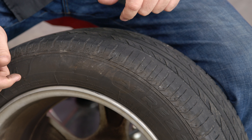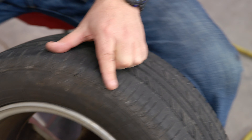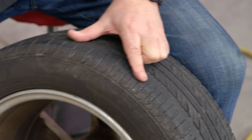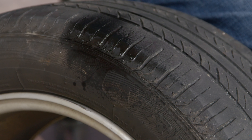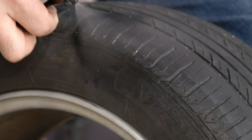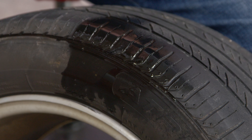Our leak is right here. Now if you have a nail or a screw or something like that, you can use soapy water — I can do it here and show you. You'll basically see it bubbling up. You can see right there where the air is coming out.